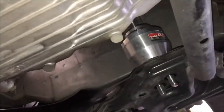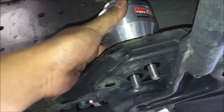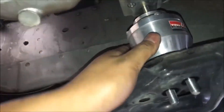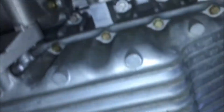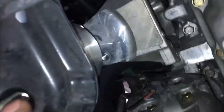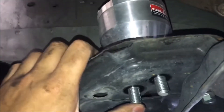We are now underneath the S2000. I need to remove this motor mount — we're going back to stock, which is this one here. The owner is right there by the way. I had the motor mount loosened and took out all the bolts on the top and bottom. I have the car jacked up from the transmission and engine area to support it. I'm going to drop it a little bit so I can take out this side too — it's pretty much loose and about to come out.